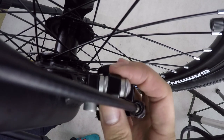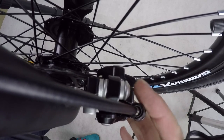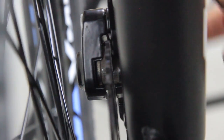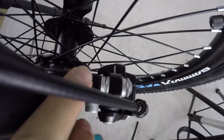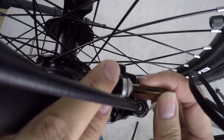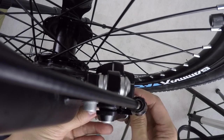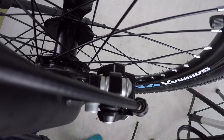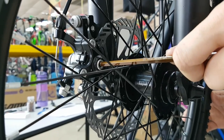You may find that the caliper mount is still moving around even after you have tightened it to the fork — that is because the 2 caliper bolts are still loose. To tighten it, make sure the rotor sits in the center of the caliper, then gently secure the 2 bolts using a size 5 Allen key. Be careful not to move it while tightening, as the part comes with an adjustable washer. If the brake is too loose after securing the anchor bolts, you can also use the size 5 Allen key to tighten the inboard pad, or static caliper. Test the brake after you have tightened it.